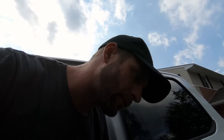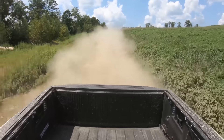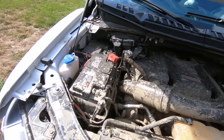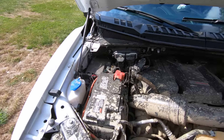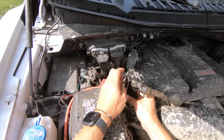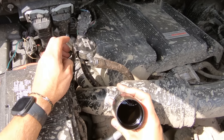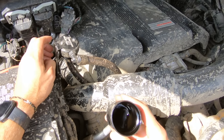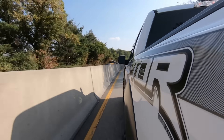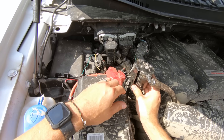It's been a couple hundred miles since we installed the JLT oil separator on my Raptor. During that time we've done the Raptor Takeover — some hardcore abuse — plus commutes to and from work, about 20 to 30 miles each way. Let's get under the hood and see what we've collected. Wow, there is a good amount of oily junk in there. This thing's doing its job. We're gonna give it another couple hundred miles, make a trip up to Buffalo, then take it back to the shop and see what we've collected.